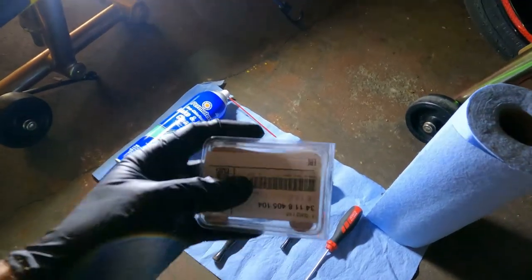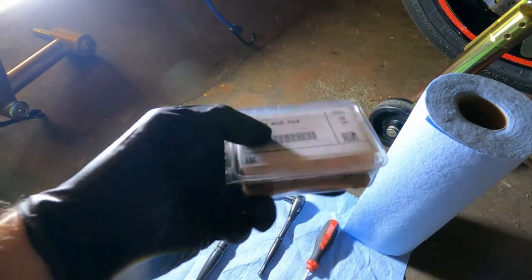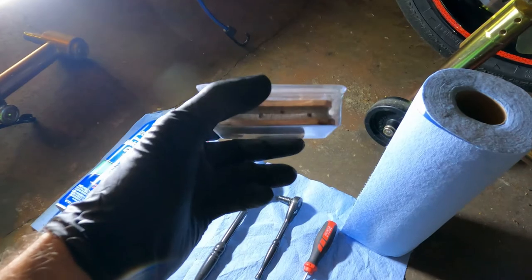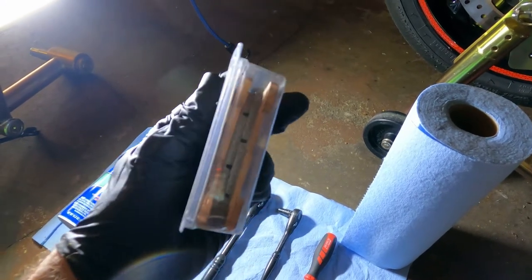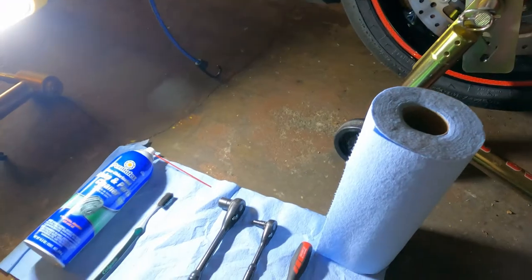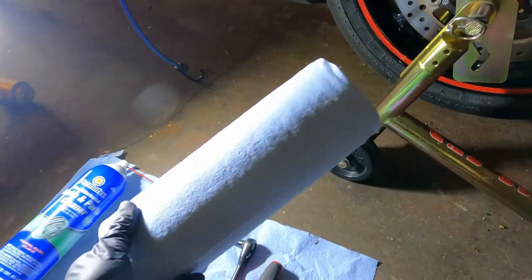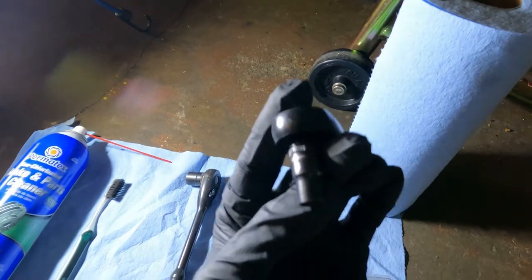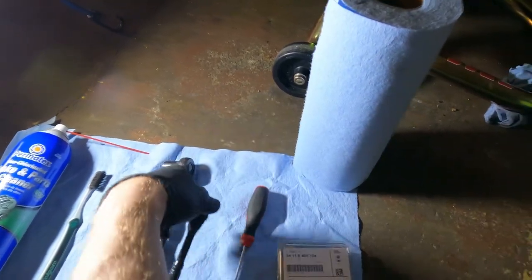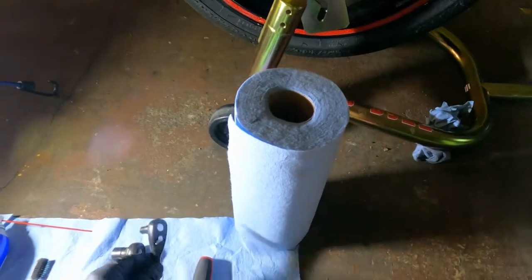What do you need for this job? You need two packs of brake pads — I'll put the part number in the description if you want to look them up. They run roughly $90 a piece, and each pack gets you through one caliper, so you need two packs for both front calipers. You'll probably want a flathead screwdriver, some good shop towels for the dirt, a size-6 socket, and a size-13 socket to remove the calipers.